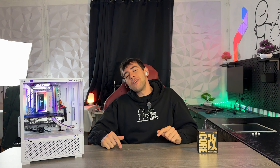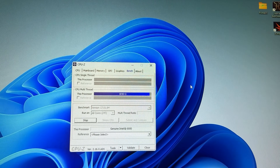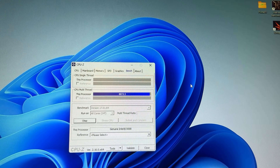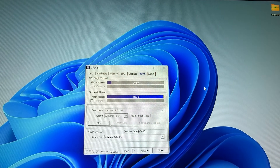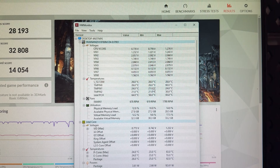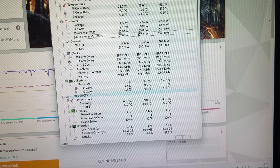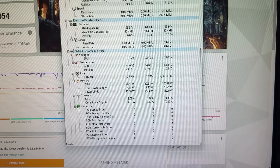You keep hearing me say it's a great CPU — let's bring some data. The CPU-Z score will also show you how the chipset is read. As you can see, you don't read the code model in CPU-Z; you just read cores, threads, and frequency. Frequency is actually pretty high. Looking at the Firestrike score with the hardware monitor report, you can see it boosts pretty high. You can actually get 5 GHz easily if you tweak it, but stock is like this. It's losing compared to the i9-12900K stock, but performance-wise in single-thread it's exactly like an i7-12700K — which you can buy on the used market for around the same price — and this is a lot faster in multi-thread. If you tweak it, you're going to land right between a 12700K and a 12900K.